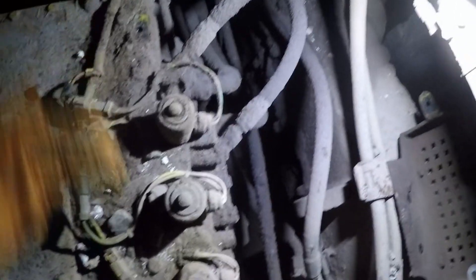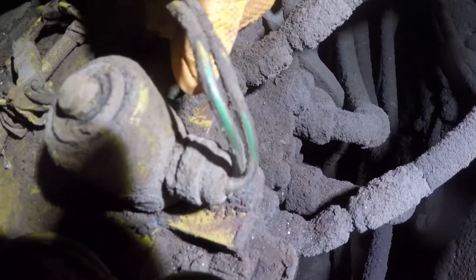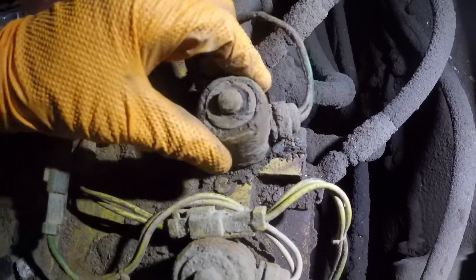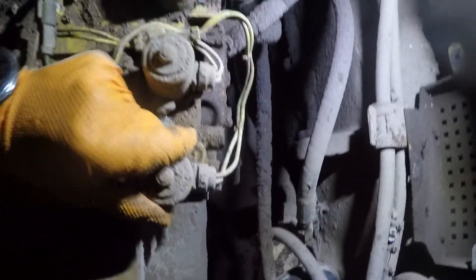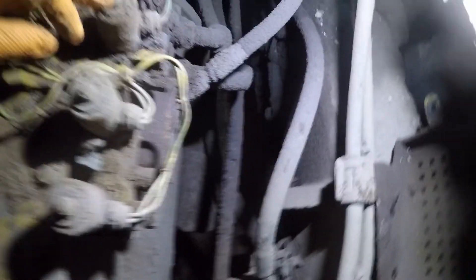We're going to scrape over, get this cleaned up, and start investigating. Took that cover off and cleaned it up a little bit — look here, you can see where it's been rubbing, but we haven't gotten through the wire yet. This is actually for the lockup, but look at the solenoid — it's all loose. The rest of them are tight. Once you tighten it down, that's it — it's tight. Let's investigate this one further and check out the wiring.